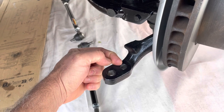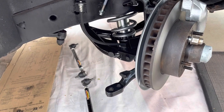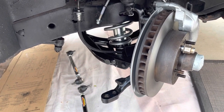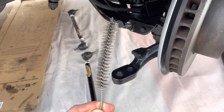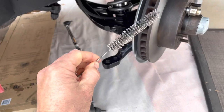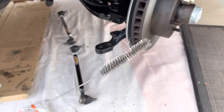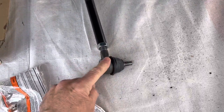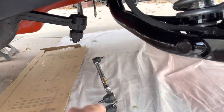I'm still pretty strong. I don't think it's going to be an issue. It's difficult to turn the wheel when you're at a standstill — that's the thing about manual steering — but if you're moving it's not bad. I'd rather have the steering a little snappier and get a little more performance so I don't feel like I'm driving a truck. So I'm going to clean these out and brush them out. Left-hand threads on the outside, right-hand threads on the inside. We're going to hook it up.